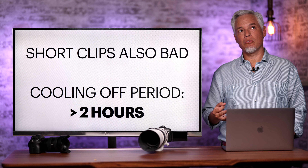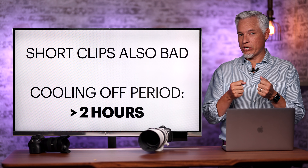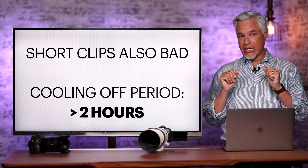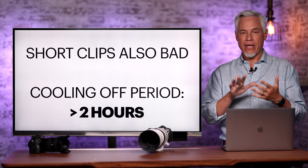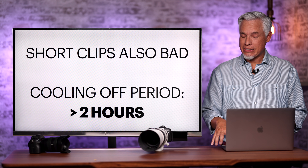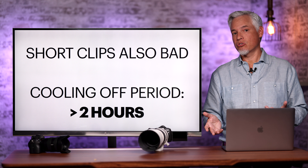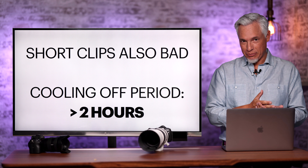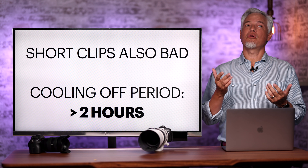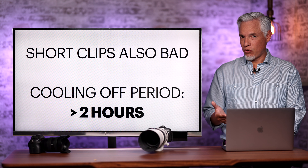Running multiple tests, I noticed these cameras take a very long time to cool off. The first R5 test lasted about 35 minutes. I waited two hours, made sure it was indoors, completely cool to the touch, battery out, lens off, door open — and it only lasted 27 minutes. That's about seven minutes lost even after two hours of cooling. This means heat builds up cumulatively from many short clips. You can probably count on around 45 minutes to an hour of total footage per day, but beyond that it gets iffy.